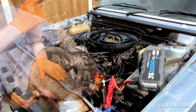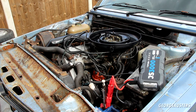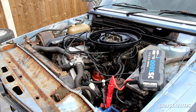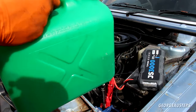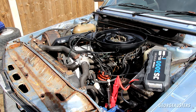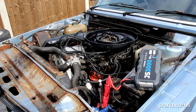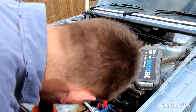I don't think that's getting fuel through. It may just need more cranking to feed through — after sitting for a few months the pipes have probably gone dry. It's definitely got fuel in it, so I'm just going to add another few liters and see if that makes a difference. The fuel pump is good, we know it works — I think there's just a lot of air in the system, so I'll keep cranking until we see fuel at the fuel filter.